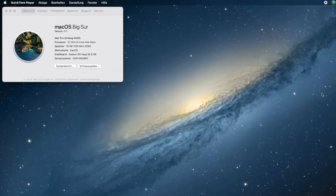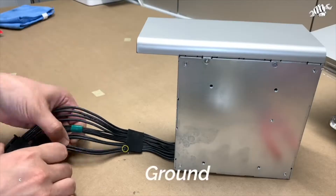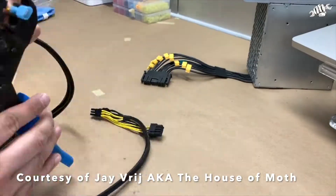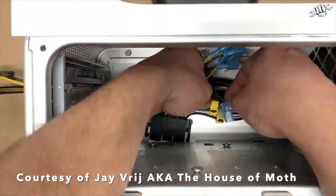They use a different VBIOS which could be flashed to a stock BIOS. In my Mac Pro 4,1 rig, I use a stock Vega 56 and the performance is just great. I don't need any Pixlas mod because the GPU has a thermal design power of 225 watts, which is within range of the PCI Express regulations.